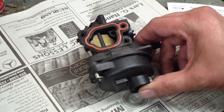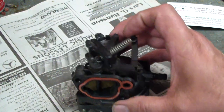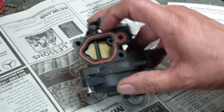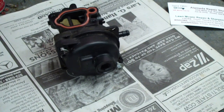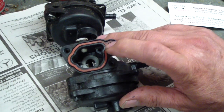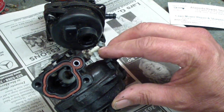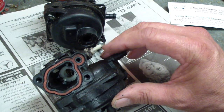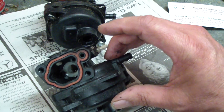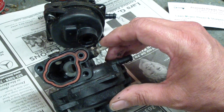There are two different kinds. There's a kind for the ones with the automatic choke, and then there's the other kind that doesn't have the automatic choke — it has a primer bulb and vents in through there. Be careful not to lose this little white piece here; that's kind of a metering valve for the air on the primer. If you lose that, it won't meter and you won't get any prime.